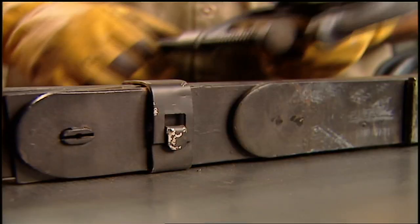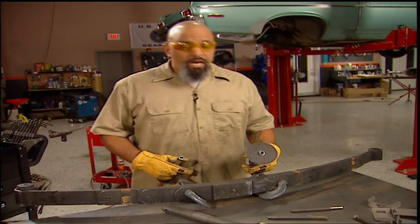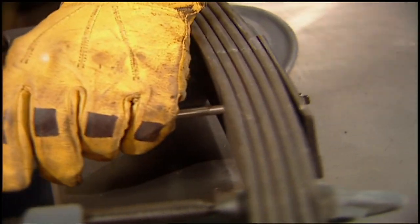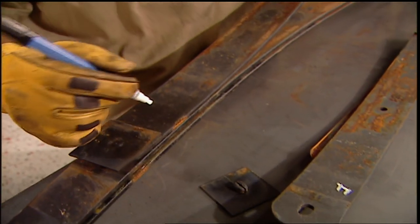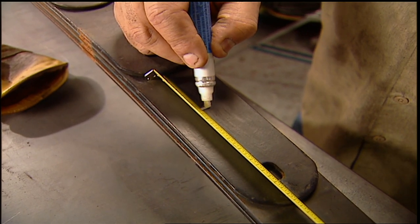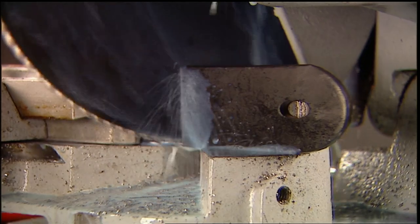Be careful when you're taking these packs apart — they need to be clamped so they won't fly apart when you're pulling off the hardware. I'm going to cut this center pin here, but I'm going to leave these two C-clamps in place just for safety. Remember, we're not cutting on the front, only on the rear of the leafs. I'll mark them to avoid any screw ups. I'm basically creating a short stagger. This Nova only needs a two inch cut — that will take out all the resistance from the rear of the leafs. If you don't have a cold saw for this, a chop saw or a cut off wheel will do the trick.